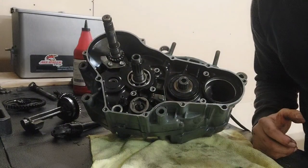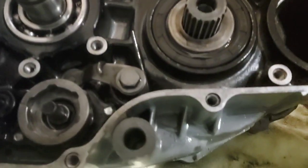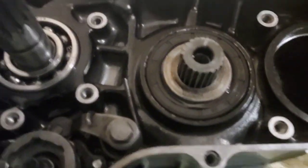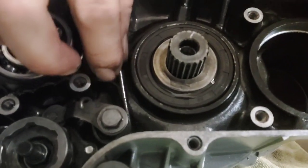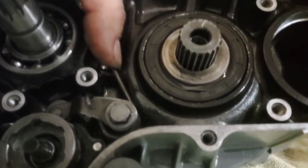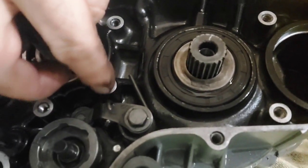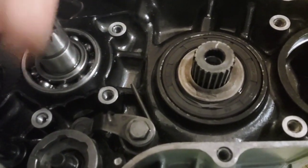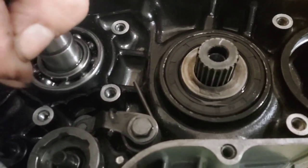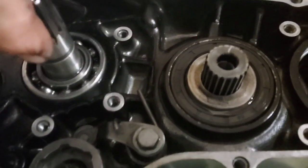I'm going to grab the phone off the stand so you guys can get in here a little bit closer. Sorry, it's going to be a little wobbly. Okay, so this is the bolt that we're working on, and this is the end of the spring. And this spring needs to come all the way down underneath this boss on the case so that it has tension on that. So now you guys know why I'm fiddling with stuff in here, because it's kind of a tight area. But I'm going to put you back up on the stand so I can use both hands.